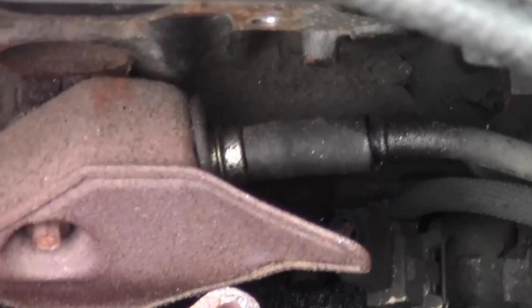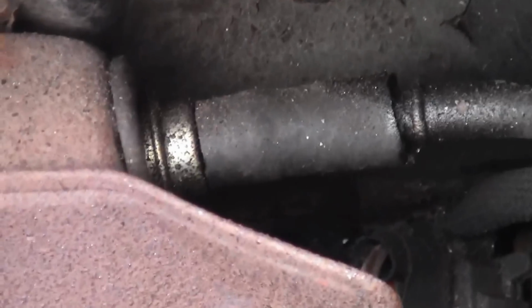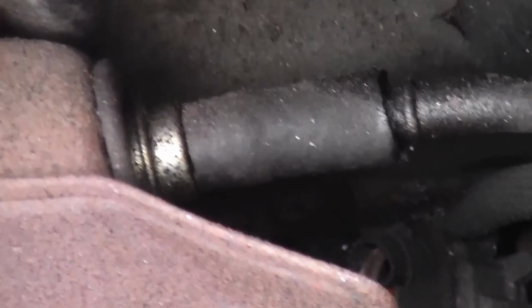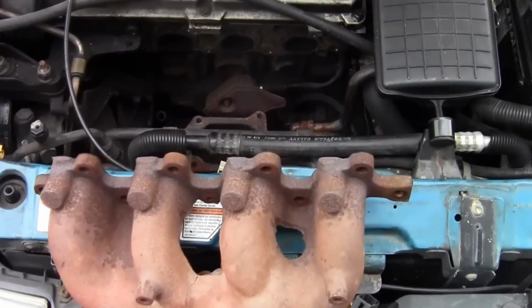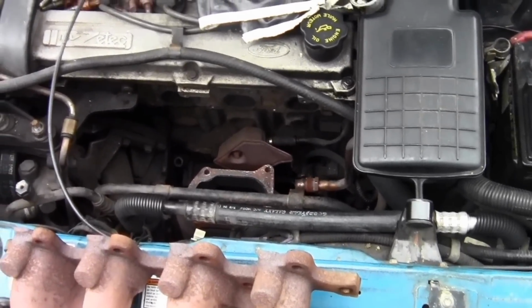And down here is the PCV valve. That shiny part right there is the actual PCV valve, the positive crankcase ventilation valve. You're going to get that out by removing a rubber sleeve there. I've got a video on that, check it out. The link is in the description. This video is just part 2, showing you how to get to it: how to access the PCV valve on a 1997 Ford Contour Mercury Mystique.